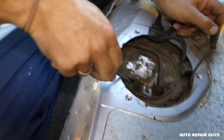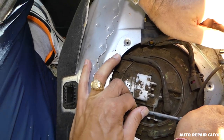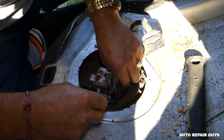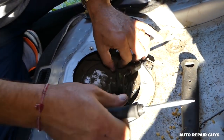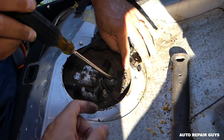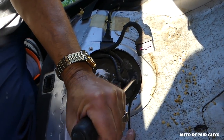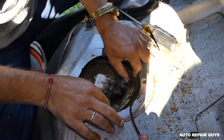It came out — we have two hoses now. Be careful not to spill any fuel. Make sure you have the battery disconnected when you do this so there's no static electricity, because it can catch fire. Always have a fire extinguisher on hand when working around fuel. You can smell that this fuel is bad — it's been sitting for a while.